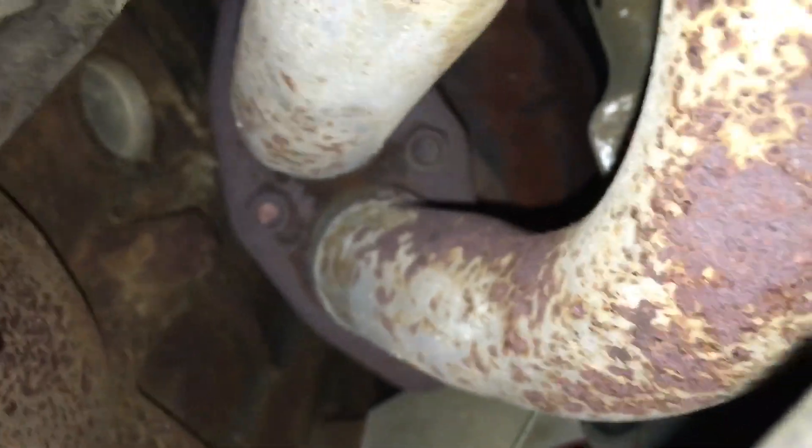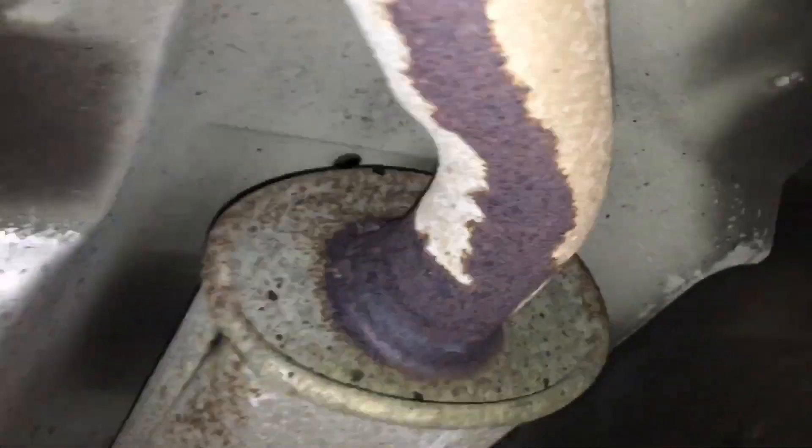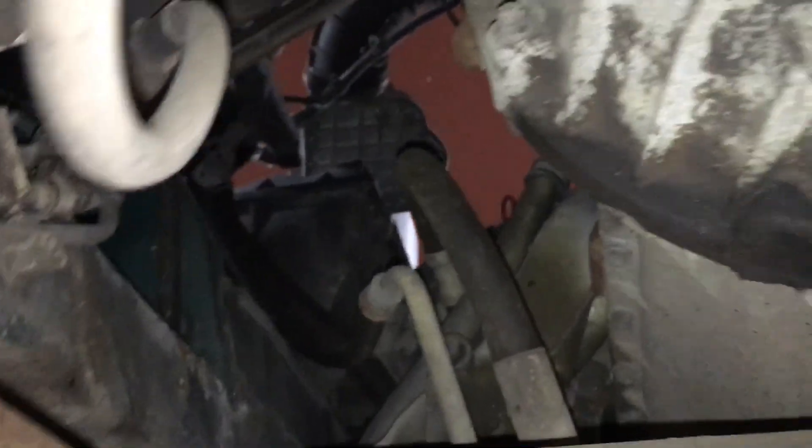Making progress. You can see the damper bolt and the main engine mount lower bolt. There's going to be a ground strap up in there somewhere on one of the two sides — this side. Four-cylinder cars are a little different apparently. Exhaust — I've actually never done an M40 car before, but there they are just using conventional bolts. Slave cylinder — even though I just put that on from the Hoonicorn, that's coming back off. Bunch of 17 millimeters for the flex disc, that comes off. 13 mils on the center heat shield. The cat-back on this car is just absolute trash. But really not a whole lot of stuff on the bottom side that has to be removed, which is kind of nice.